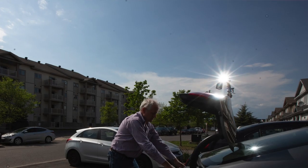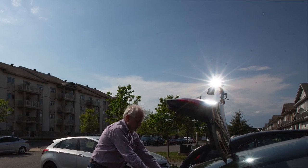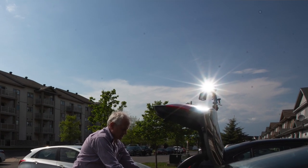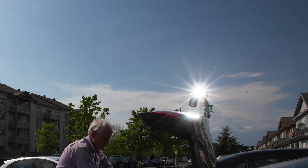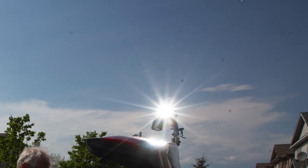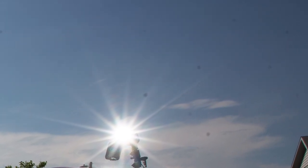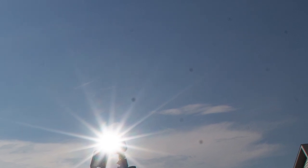If any dust gets onto that sensor, that is not a good thing — and dust will get onto that sensor. Especially when you're using small apertures like f16 or f22, in other words high f numbers, and you take a picture with a clear background like the sky, you'll see grey dots — dust bunnies as we call them. They're really annoying because that dust interferes with your pictures. You can remove it digitally, but it takes a lot of time.